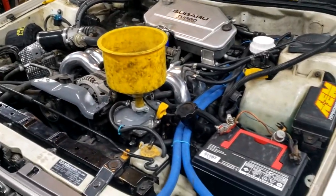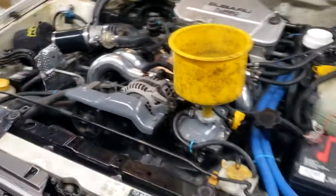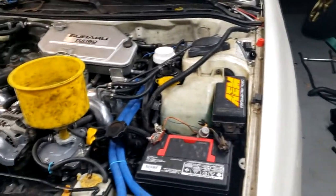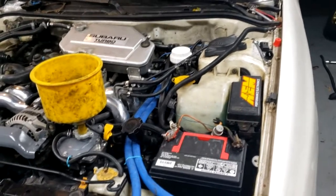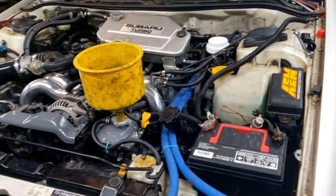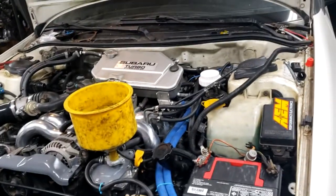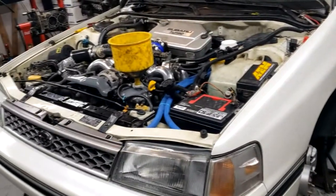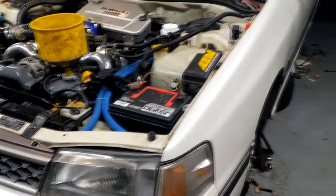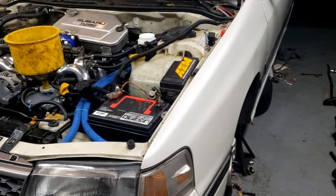As you can see, I got it running! It ended up being something really stupid. One, I updated the firmware and software for the Haltech, which helped. But I had the MAP sensor set to the stock MAP sensor and I'm using the onboard MAP sensor on the ECU. I didn't realize I had to tell it that, but because it was a base tune for WRX it was set up to use the stock MAP sensor. Changed that, and then it fired right up and idled.